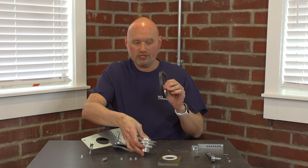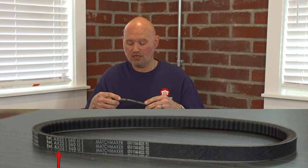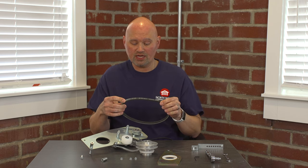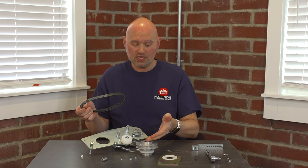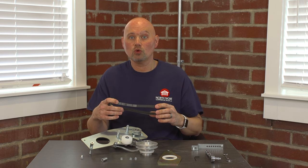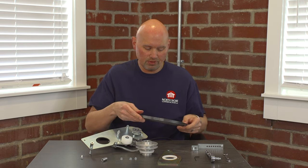Pulling the pulley out will allow us to take the belt off. There is a wide range of belt sizes. If you need to replace your belt, they have printed on the flat side of the belt an AX two-digit number. If you can provide that to us, we can provide you with a replacement belt. Worst case, if that information is worn off, you can give us a call — with a tape measure in hand, we can size up over the phone the motor pulley, drive pulley, and other features to tell you what belt needs to go back on.